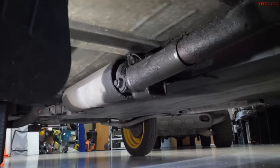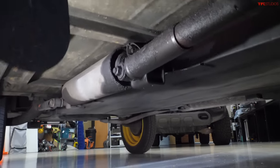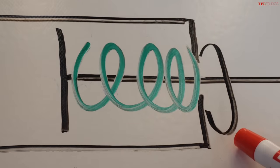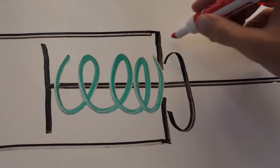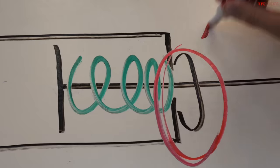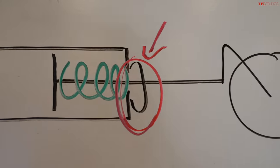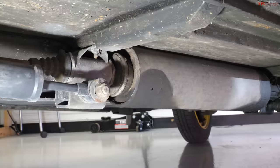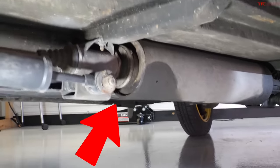Now, this would be smart, giving you four-wheel independent suspension on all four corners, but it goes even further than that because the entire tube assembly itself is actually suspended on its own set of rubber bushings. These little bushings were actually steel on the early cars and then rubber mounted on the later cars, but this right here is really the ingenious part of the 2CV suspension setup, because the fact that the entire spring tube can move back and forth means that the front and the rear suspension is interconnected.